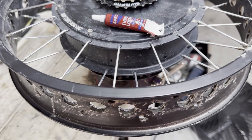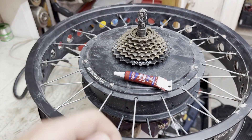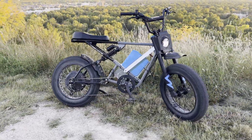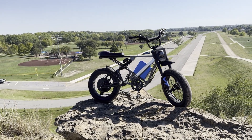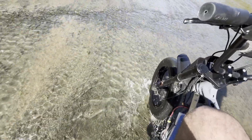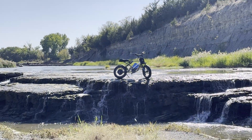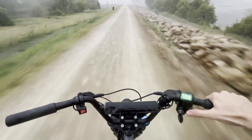Because the spokes are straight spokes they're constantly loosening up, so I went around the motor and installed Loctite on all the spokes to make sure they never loosen. After putting the bike back together I took it to a nearby town to go exploring. That was one eventful ride.